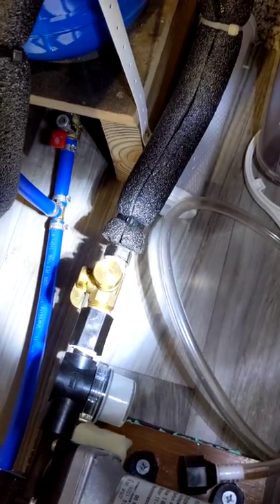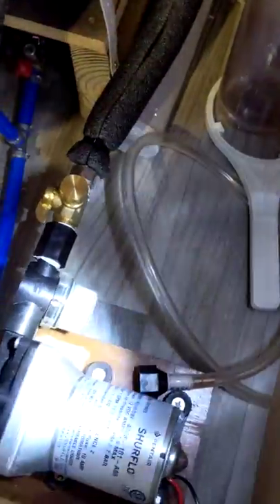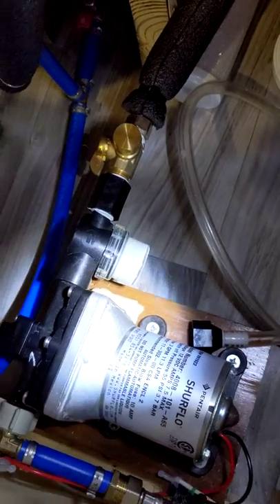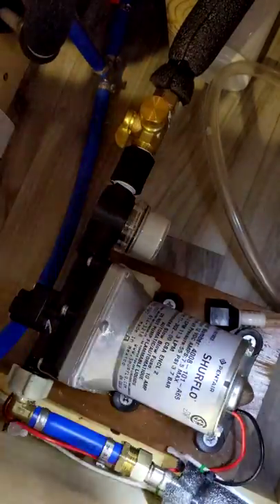The one thing this doesn't do — I'll show you. This is my water pump setup. Your water pump is going to be sitting down here. There's the winterizing connection where I can pump in the antifreeze. You've got your suction strainer and the pump. This section from the suction line of the pump down into the fresh water tank and through the pump back out to where the city water line connects — that part doesn't get blown out with air, so there's still water in there. If you're not going to flush antifreeze, you want to unscrew that little filter housing, make sure there's no water in there, drain that out, and you might even want to pulse the pump a few times. There is a check valve inside this pump, so the discharge side will still be full of water — if you pulse that pump it might blow some air through there and clear it out. I'm going to pump a few gallons of antifreeze through here so I don't have to worry about that.